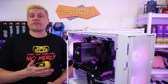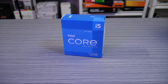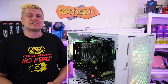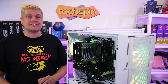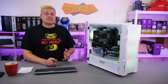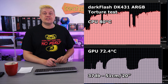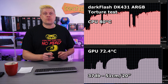For the Dark Flash DK431 we're using our test bed: an MSI B660 Mortar Wi-Fi DDR4 with an i5-12600K and Cooler Master Hyper 212 LED Turbo ARGB — though only with a single fan. Our graphics card is an ASUS RTX 3070 08G gaming at 300mm long. At 24°C ambient with the four stock fans, we're idling at 30°C for the CPU and 39.3°C for the GPU. We ran the torture test with Blender Classroom and Unigine Super Position together three times; the CPU maxed out at 80°C and the GPU was at 72.4°C. Case noise was 37 decibels at 51cm, and the internal Hyper 212 was the only fan speeding up, so that's it for case noise.